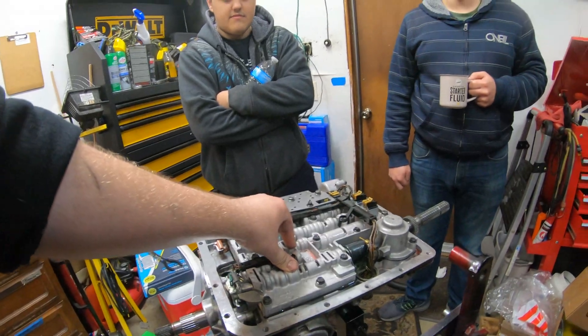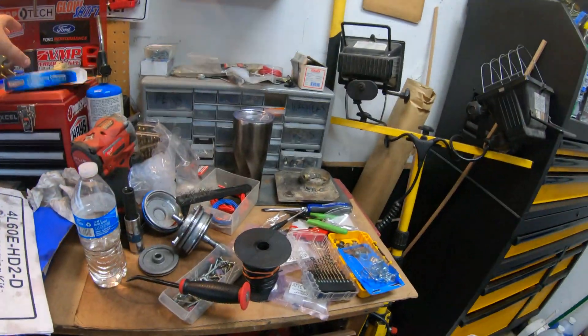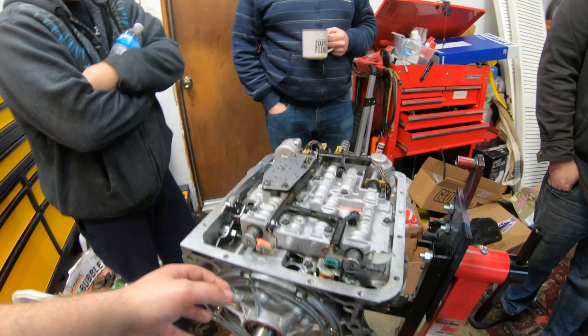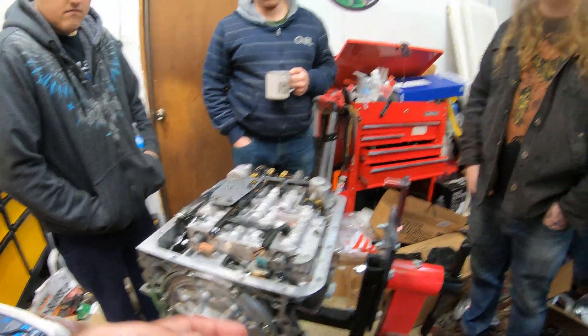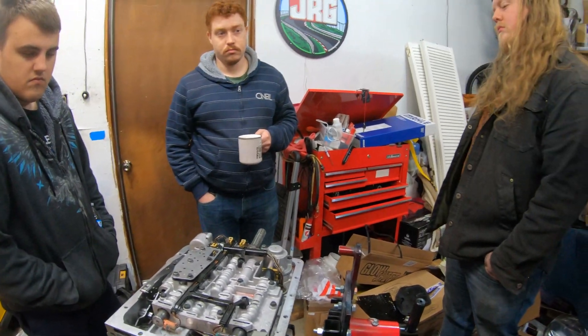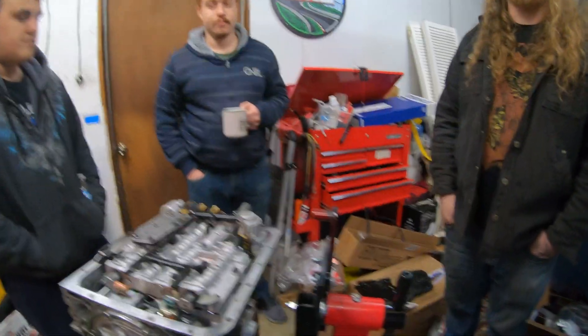This transmission is complete. The Trans-Am has full permission to come on over. This was a Transgo kit — amazing instructions on everything. You don't usually get instructions on this stuff, which is really cool. Unfortunately we did not do the input drum reinforcement because there are a lot of springs involved. We should have looked in the Transgo box when we were doing the initial part of the rebuild — that would have been the perfect time. We did take the whole drum out, but it would still require us to take apart the drum and all the clutches to knock out some stuff — it would be a huge hassle. Down the road, if we want to put the drum reinforcement as well as the rest of the shift kit stuff, we can.